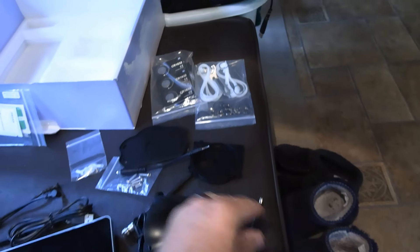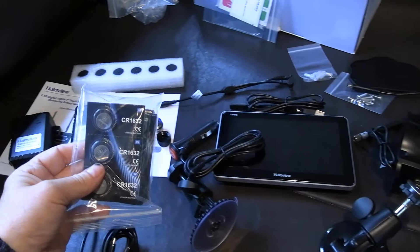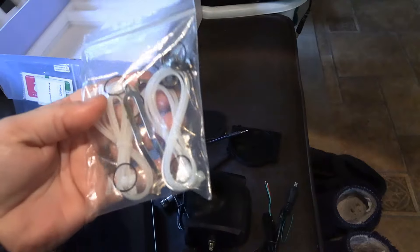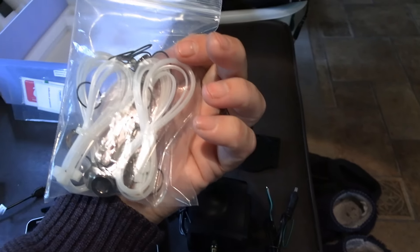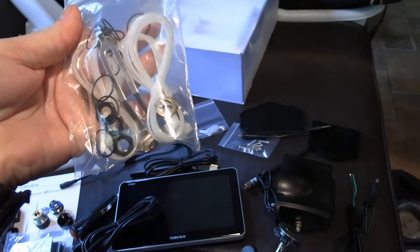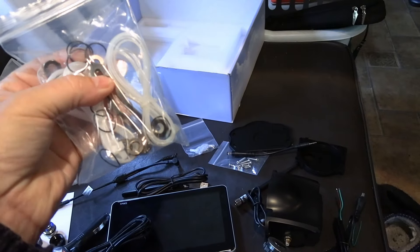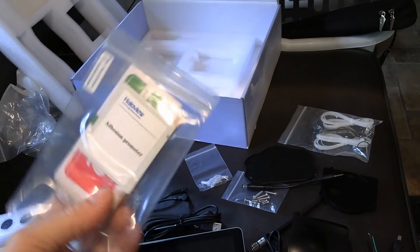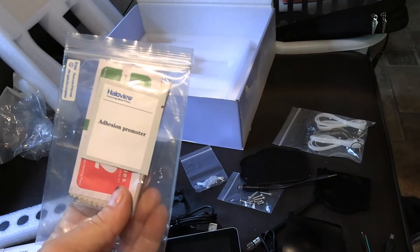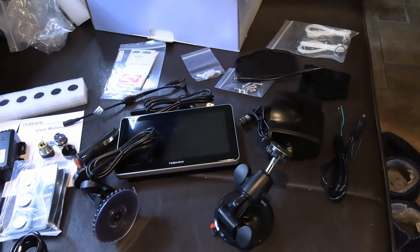If there's no pre-installed jack, this wire lets you find 12 volts — a lot of people use the back running lights. I have built myself a 12-volt junction box that I also use for my cell booster wiring, so it's already up there and makes it easy to connect. They also include batteries — looks like CR1632 — and a little pack of goodies: zip ties, gaskets, O-rings as spare seals for the pressure monitors, backing nuts for tightening the sensors onto the tires, a little tool for that, and some stuff for mounting and cleaning if you're mounting on the windshield. Quite thorough packaging.